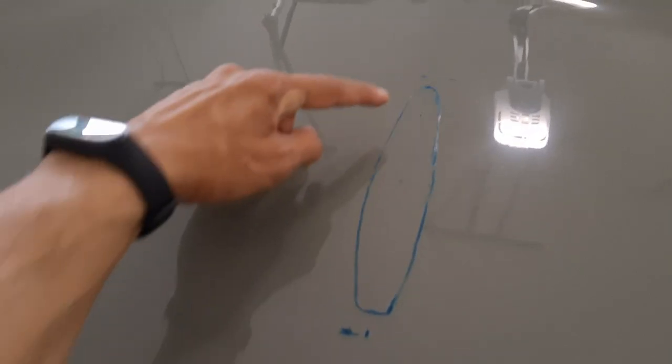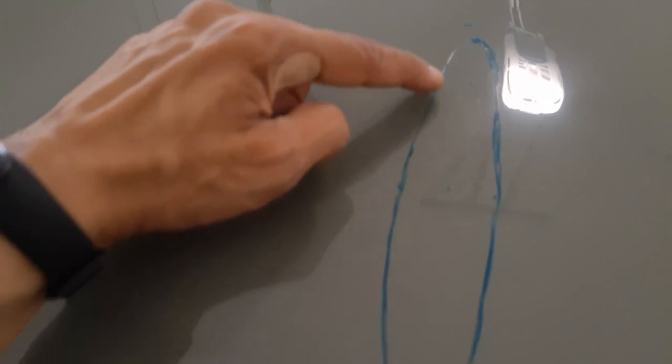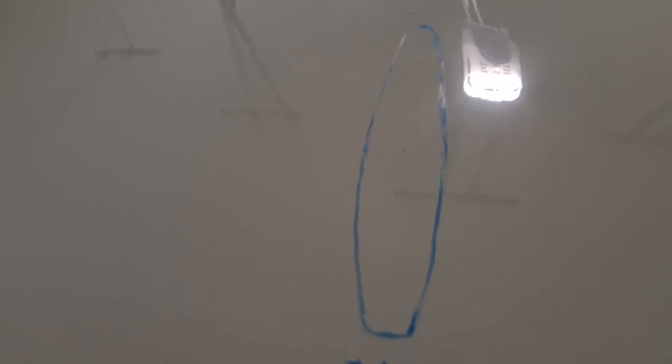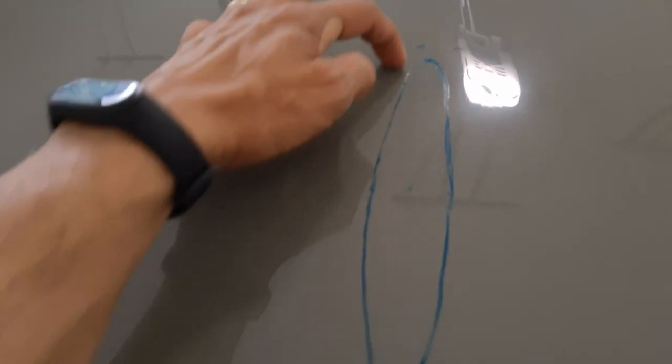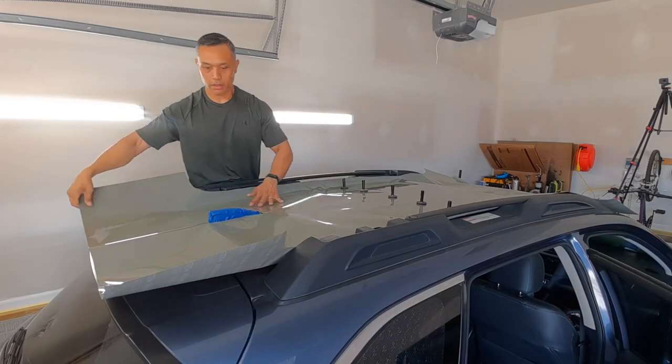From the very back with a little bit of excess going forward, I've drawn out the antenna. These marks here indicate the actual total length of the antenna, and I drew a cutout that's going to be slightly smaller — about half an inch shorter on each end. The total width at the very base is two and a half inches, so I made this cutout an inch and a half wide. That's not quite big enough to get all the way around, but big enough to drop it around to get started and work my way down from there. I'll cut this out, then as I peel back the vinyl I'll drop this piece right over the antenna.